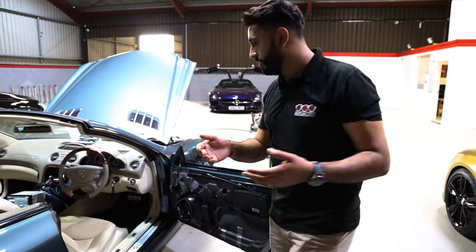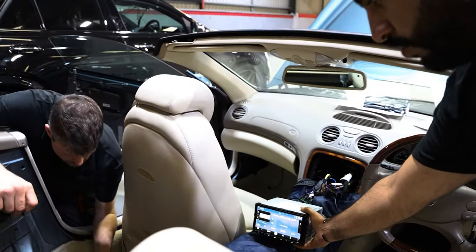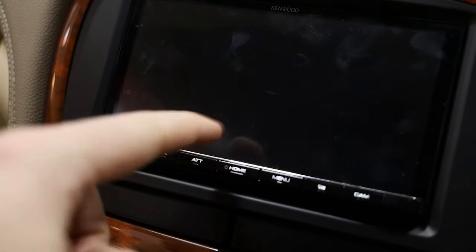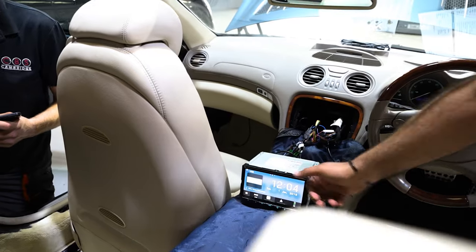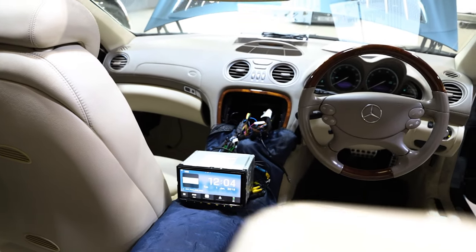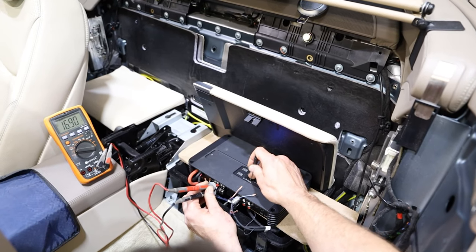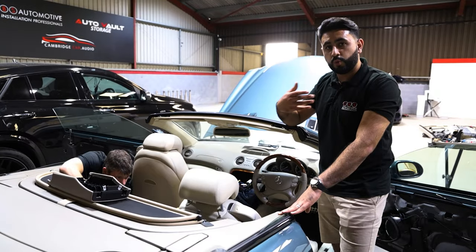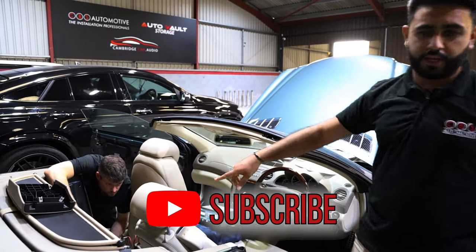We're also adding functionality into the system. The radio is on at the moment — this is the Kenwood 1819 unit, which features wireless Apple CarPlay, Android Auto, and digital radio options. It has a seven-inch touchscreen with volume up and down. What's playing via USB right now is a sine wave. Carl is doing the setup of the amplifier — playing certain tracks via USB since it doesn't have a CD slot, then measuring and doing the mathematical work to get the voltages correct and set the gains on the amplifier. The amplifier is sitting behind the passenger seat.